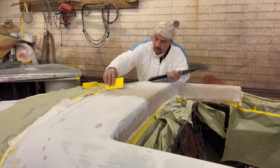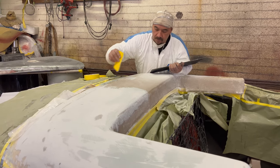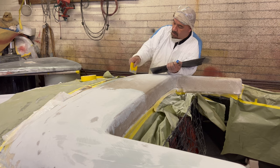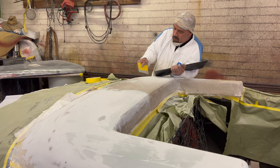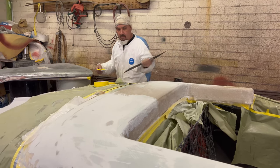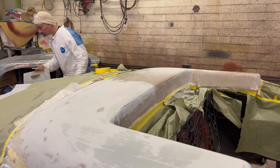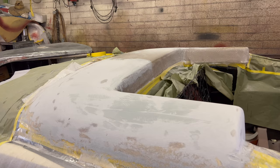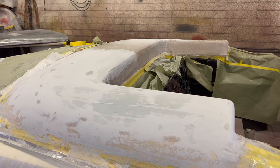Then we'll make a mold off of it. The master is no longer of any use to us — we can make all the male parts that we want, the master being male and the mold being female. So now we're going to make a part, take that part off the new mold, put it on the car and make sure it fits properly. If we have some problems with it, we can address it at that time. Right now we've just got to get one good one out the door. Then that'll go to the body shop, and the body shop will cut it in three pieces later. But right now we want to get it all in one piece, mounted to the car so it can get to the show and be painted the color of the car.